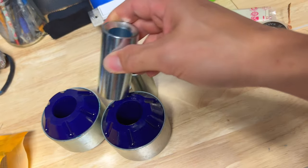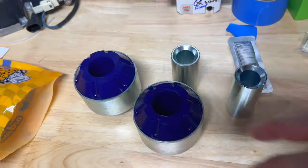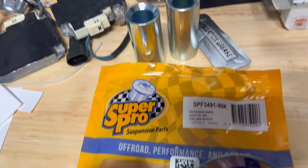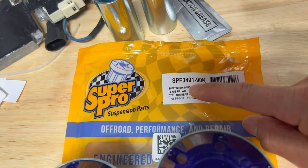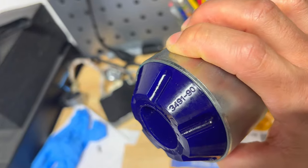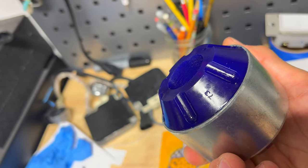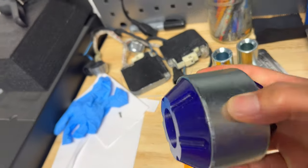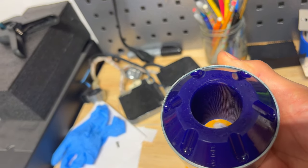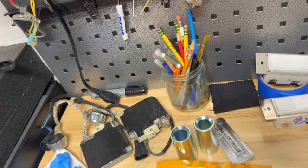I have to press this thing into the bushing because I measured it earlier and this sleeve is like two millimeters bigger than that hole. So I'm going to try to press this into here before I put it into the actual mount itself on the car. The part number on here is SPF 3491. Without the dash 90k, it's the standard version. You can actually see it printed right on the bushing itself. On the back side it has a 73, which I'm not sure what that stands for - maybe the batch. Inside, you can see it's got that ribbed edge where the grease sits, so it doesn't dry up inside those pins.